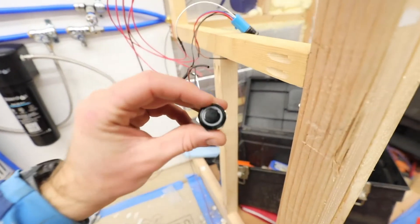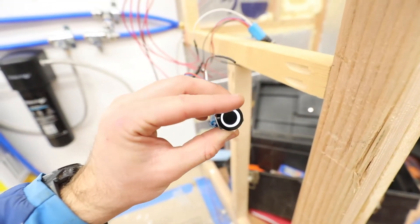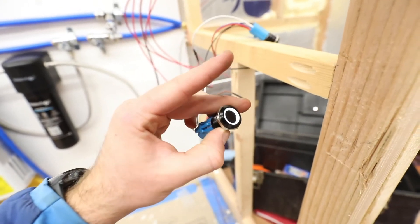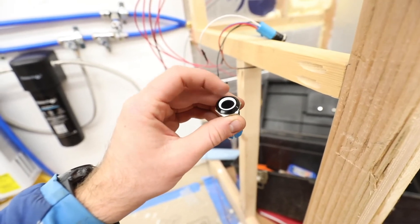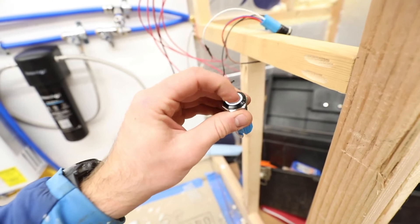This evening I came back out to the bus just to do a little bit more work, and in the last 10 minutes I wired up the switch that controls the solenoid on the propane tank. Let me show it to you. There it is — when it's activated the light shows up so you can see it, and it's depressed so you can feel that it's on. Click it and it turns off. Listen closely when I turn it on — that click, that's the solenoid actuating when I power it. That circuit is done.